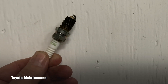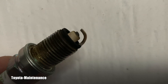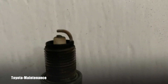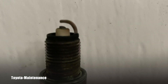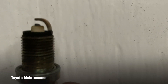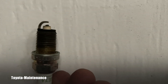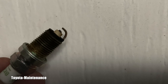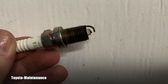I promised you a detail of the tip on that NGK spark plug. Do you see how it's basically missing — how it's burnt off? There is what I'd call a hook, the part which makes that quarter turn, and the tip on the spark plug — the back of it is basically missing, it's sloping down. The gap is too wide, and that is a clear indicator these spark plugs are way too old and it was definitely time to replace them.